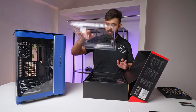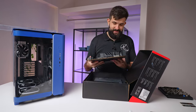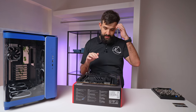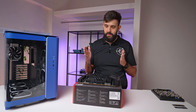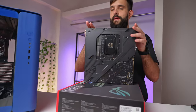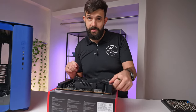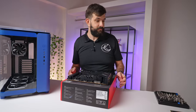One thing that's kind of funky about this board — it's insanely heavy. This is also a good test for the case because it's actually an extended ATX, or EATX board. A standard ATX board would end at a certain screw hole, but we have about two extra fingers of width. I might need to change some standoffs inside to accommodate it. I'm pretty sure this case supports it since it's a very big case, but we'll just do it live.